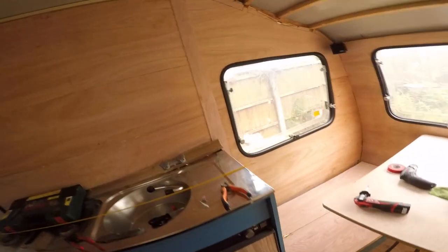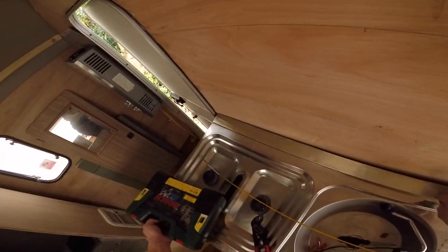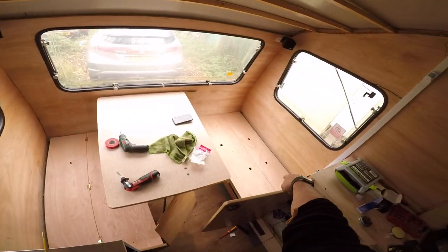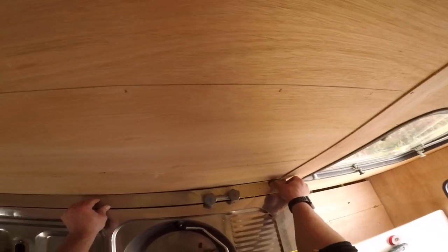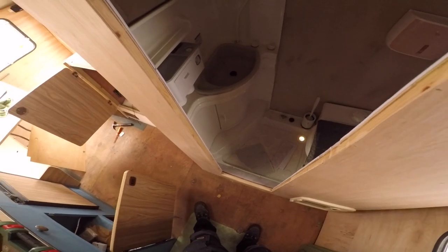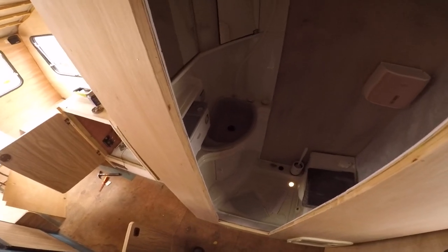I did run the micro switch wire from these taps - it's joined there and there's a wire running to that box there. I will connect that one also today. Another thing I need to do is put some Sikaflex where the cracks are on this shower tray. And hopefully by tonight I can test the hot water and the water system.